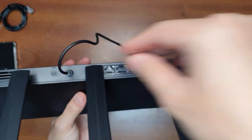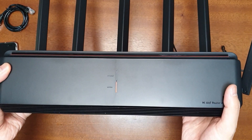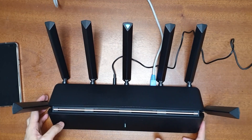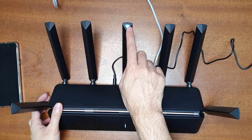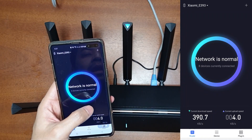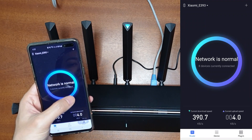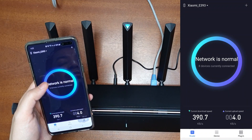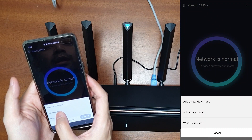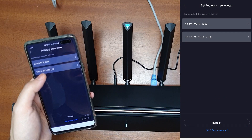The power is now connected. The system indicator is red and we need to wait for it to turn blue. I'll connect the LAN cable to the WAN port. The indicator has turned blue and the middle antenna indicator is also lit. Now let's go to the Mi Wi-Fi app. This app is not the usual app from the Play Store or App Store — it's a custom translated version of the Chinese app. I introduced it in a previous video; the link is in the description below.